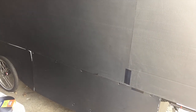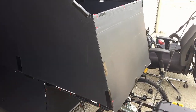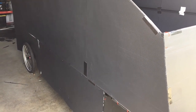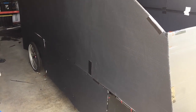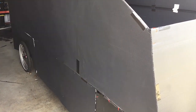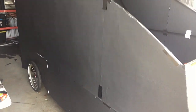Okay, here we are. All the outside has been skinned with Corflute. So it was three pieces of 2.5mm Corflute that I got from Bunnings, and I Sikaflexed them all together in one direction — one piece vertical, next piece horizontal, and the next piece vertical. Kind of like that. And yeah, that's the finished product.